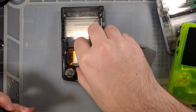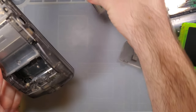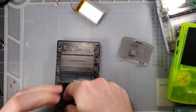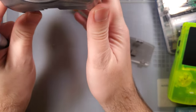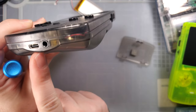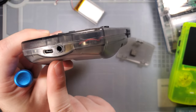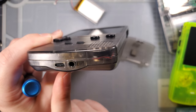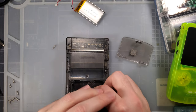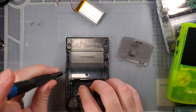Going into the battery compartment, you might notice a familiar-looking battery cell. This is the exact same battery cell that Funny Playing uses in their Game Boy Color and Game Boy Advance battery mods. The housing itself is modified — on the bottom there's a hole for a USB Type-C cutout. Unfortunately, this alignment does not work with the Giltessa battery mods, so if you were thinking of swapping in your existing Game Boy battery mod — sorry, it's not going to work. The ports are in two totally different spots.